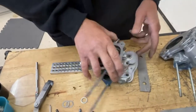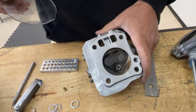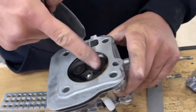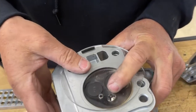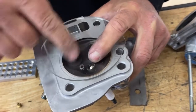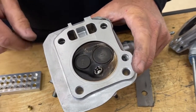You'd love to get the spark plug as close to that divot as you could. By pushing that spark plug as far into the hole as you can get it, you're taking up cylinder head volume, which gives you higher compression, and you're also getting that spark as close to the intake valve as possible — and on top of the piston. If you don't believe what we're saying, you can always CC the head. Put a piece of plexiglass on the head with a little grease around it, drill a hole in it, and with a burette tube fill it with a thin liquid like alcohol or transmission fluid to get a CC reading. You can drastically increase compression by using different length spark plugs.